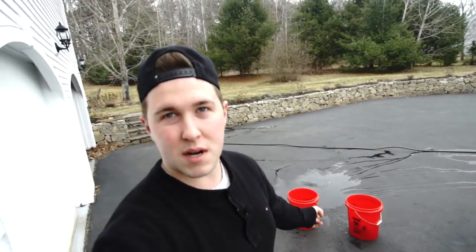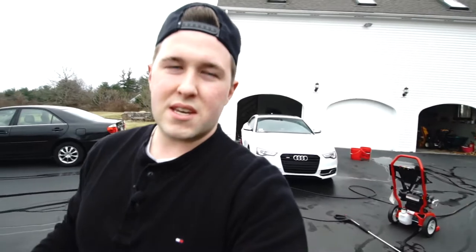As you can see, I sprayed the whole car down and got most of the dirt off, but that usually doesn't get all of it. The next step is I fill up one bucket with totally clean water and the other one with a little more soap. After we foam the car, we'll wipe it down with a scrubbing cloth. Usually I only do this two-bucket step if I'm in a rush or going to a show quickly and not going to clay, wax, or polish. Today for the demonstration I'll wipe it down properly with the microfiber cloth so we can actually see how this stuff works.